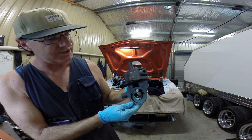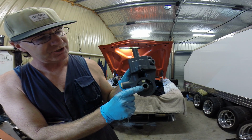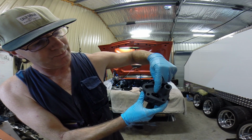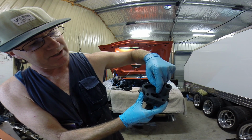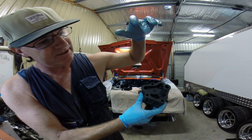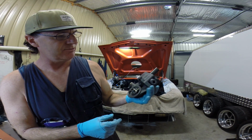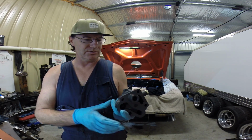Well, I'm going to the next stage, and I'm actually going to drill them out just ever so slightly and increase the diameter right through the whole pump. They've got a terrific intake. This needs a little bit of a grind through here because it actually interferes with the block off the motor. So we're going to do like I did in the other one, just do a little bit of grinding so we get great entry, and then increase the diameter, do all our little tricks to it to increase the flow on over the alloy style Holden oil pump.